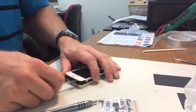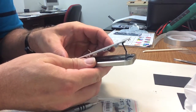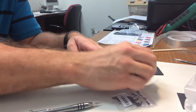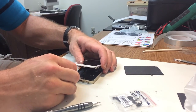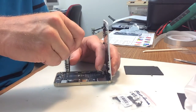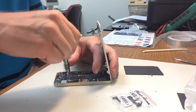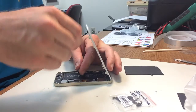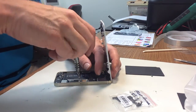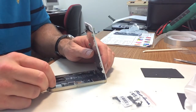Got to be careful with the home button cable — as you can see right there, you don't want to snap that. Disconnect that carefully at the little clip. And then before you do anything, disconnect the battery. It's important, especially on iPads — you can usually short circuit and fry your LCD, or the backlight filter on the logic board and have to do some micro soldering. So definitely want to unplug the battery before you do anything.